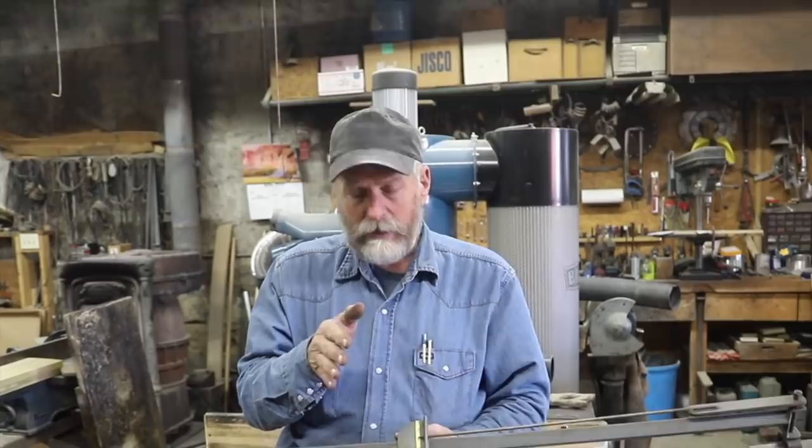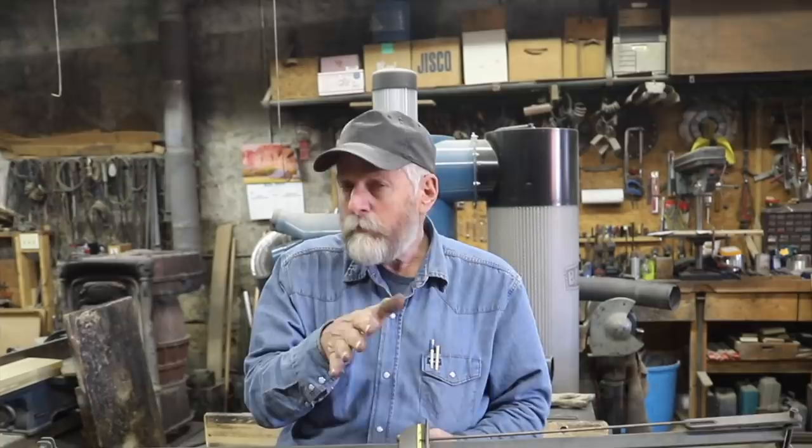Well, in a buggy or carriage, we are concerned about what would be camber on a vehicle. It's called swing on a carriage. And the third thing in a vehicle that's measured and adjusted is the toe-in. Well, that is also a concern on a buggy or carriage, and that old term is called gather. So we adjust a buggy or a carriage not so much for caster, but we do for camber and for toe, and those old terms are called gather and swing.